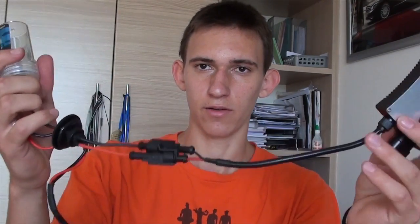Ballasts come in different shapes and sizes. These are the slimmest ones I could get — performance-wise they're worse, but I just wanted a really cheap and easy-to-install kit. I wasn't planning on doing this mod right now, but I found this kit at a good price so I went for it. You'll need a place in your engine compartment to mount your ballast, and you want it close to the bulb because the wire that comes with the kit is quite limited, so you can't mount it too far away.